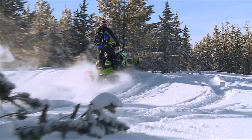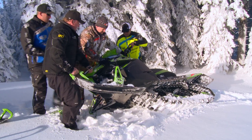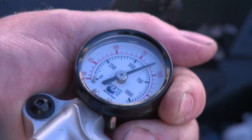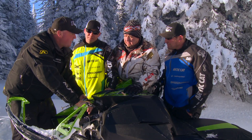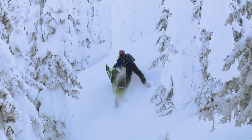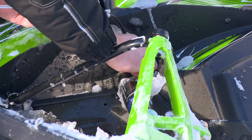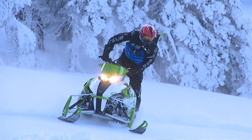Okay Dave, Rick wants to make some changes — what do you think it needs? I think we just need to take the air pressure down just a little bit so it's going to roll into the mountain a little more and make it easier to side hill. How much would you let out — what would be an increment amount? A large adjustment would be about five pounds, and a small adjustment would be about two and a half pounds. So Rob was pounding the trails and it felt great, but now he wants to side hill and soften it up a little. First thing we're doing is dropping the air pressure about five to ten pounds in the EVOL chamber — that'll allow him to get into the hill a little easier and make it roll up just a little easier for him.